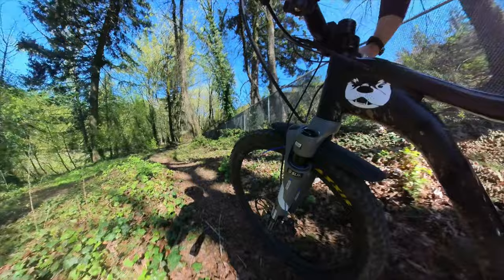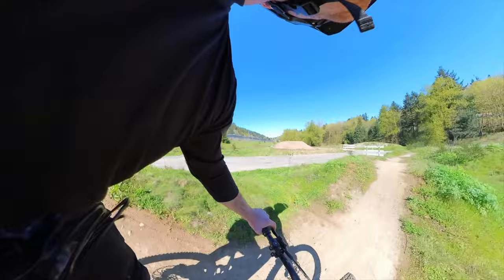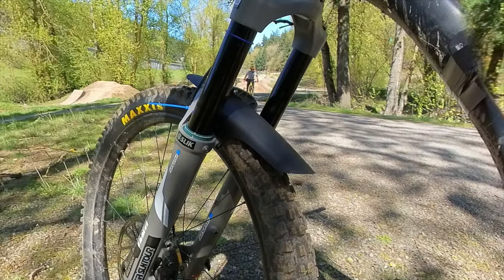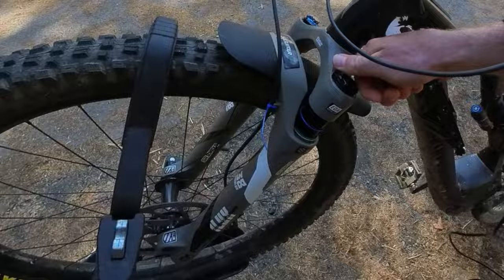Even though there was no visible air inside of the damper, servicing your damper oil is some of the best things you can do for your bicycle. It does have some additional traction and when it came to jumping the fork was definitely improved. After fully assembling it with the oil bath it is quieter, but it will puke out of the side and contaminate your brake pads. The lower leg runs a dry system and it was chewing up the bushings — it looked like a bunch of powder inside of the fork — so that's why I keep putting oil in the lower legs, because I want the fork to last longer. After that first ride I took it out again and the fork was too linear, so I'm gonna put two tokens back in — that's usually what I run in a Fox 38. The entire time I was chasing an air spring problem it was actually in the damper — good lesson to learn.